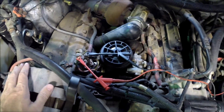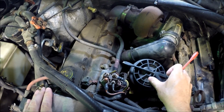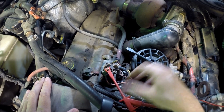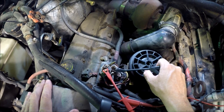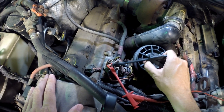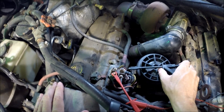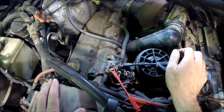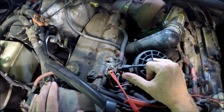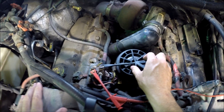You can see the relay is right here. I've got these multimeter leads hooked up to it. We're going to do a voltage drop test. A voltage drop test actually shows us the resistance in the relay itself. I'm going to put my red lead on the wire that connects essentially right to the battery through a fusible link, and then connect the other one to the output side — it's got two wires that go to feed the glow plugs on each bank. I've got my multimeter hooked up that way.